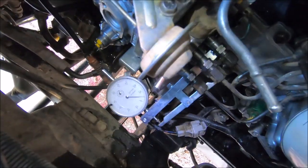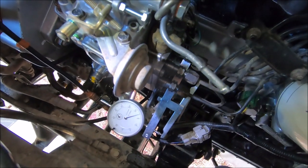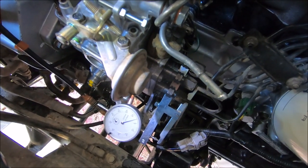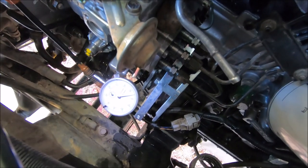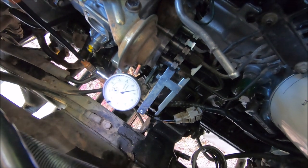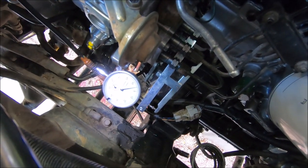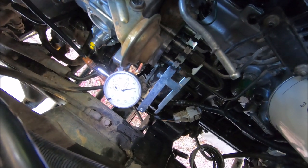So what I'm going to do is time that correctly and hopefully that solves my problem. I'll show you what I'm up to here with my dial indicator. So what I've got is my dial indicator and adapter screwed into the back of the fuel pump, which goes in between all of the injector lines. There's a bolt in there with a copper washer — remove that and you screw your adapter and dial indicator in. The adapter you can pick up on eBay; I think I paid like 70 bucks for it. I can't remember the exact part number but if I find it I'll put it in the description.